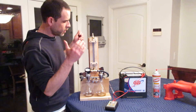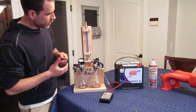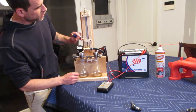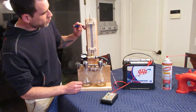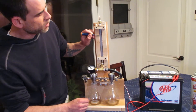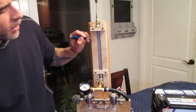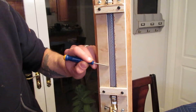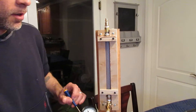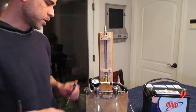There are a couple of ways to measure how much fluid came out of the injectors when you do a fixed number of pulses on each. You can either measure how much fluid collected in the little bottles, or you can put measuring marks on the clear tube and pre-measure volumetric amounts — like how many cubic centimeters or milliliters drop down. So if the fluid drops from a certain point, you can see that you've displaced 20, 30, 40, or 50 milliliters. That's another way to measure based on volume coming out per five pulses on each injector.